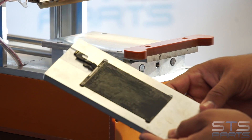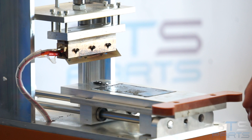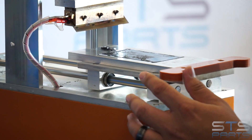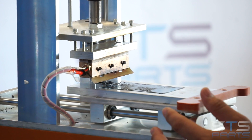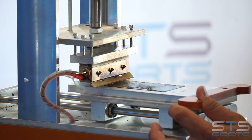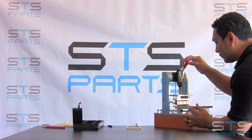The mold will give better support to the LCD through the process. We're going to set this mold and the temperature is right under 300 degrees — ideally we want it to be at least 300 degrees. What we will do is go ahead and align the blade with the beginning of that LCD polarizer. See how that's where it starts — that polarizer. I'm going to pull it down, but I'm not going to push it all the way down. I'm just going to sit that blade on top of the screen; I'm not going to lock it in place.